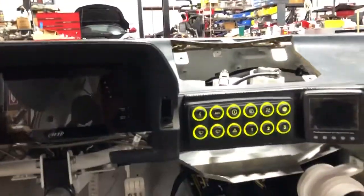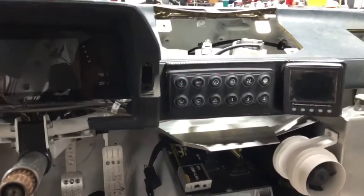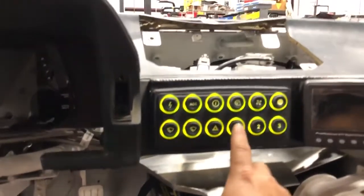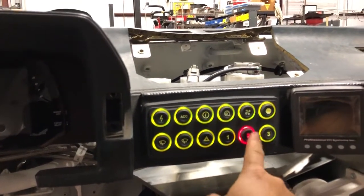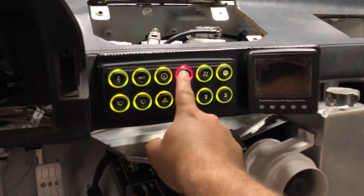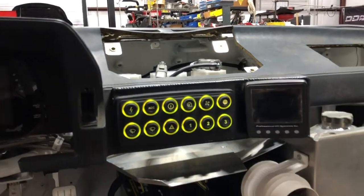The CAN switch panel is on because the power is on. If you turn the power off with the main power switch, it goes off, and turn it back on, it comes on. If you want to turn stuff on, you can go ahead — that's the cool suit, I can prime the fuel pump, I can run the blower. That bilge blower blows through two ducts up onto the windshield and basically serves a defroster function.